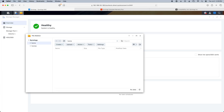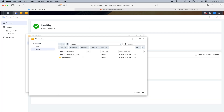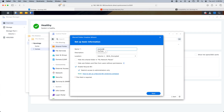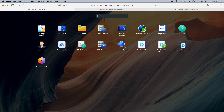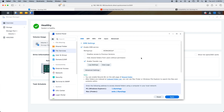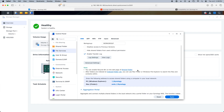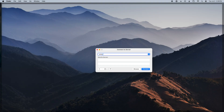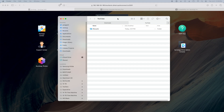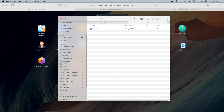At this point, I'm nearly done. I need to open up File Station and create a network volume. This is really straightforward, and I don't need to encrypt the volume since I'm already encrypting the pool itself. I'm going to add in Enable Data Checksum for increased file integrity, but skip file compression since this is for my YouTube videos and not deep storage. You can also configure user permissions for the volume to create access controls. Finally, I need to go to the control panel in File Services and enable SMB to share the volume to Mac and Windows. The helpful UI will let you know the address on your network. Then I can go to my Mac, connect to server with the login and password, it'll mount my Synology, and from here I can start moving data into my storage pool.